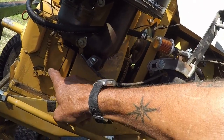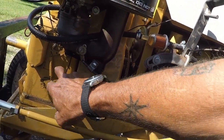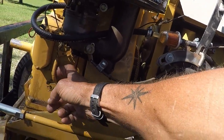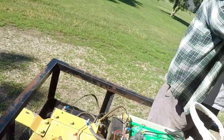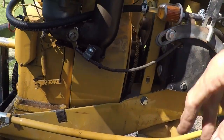It is missing one spring on the governor. Okay. It's missing a spring on the governor. You got one? Yeah, I should have one. If not, we can steal one from one of them I brought over. One of what? 23Ds I brought over. Oh, yeah, the three that you brought over. Yeah, or the two that you brought over. That's probably what we'll do.